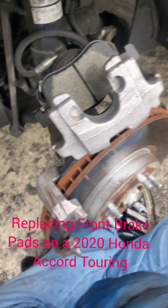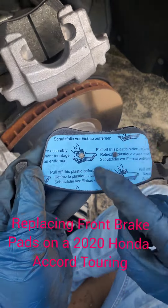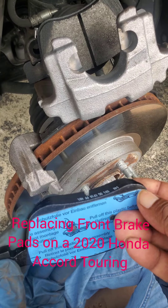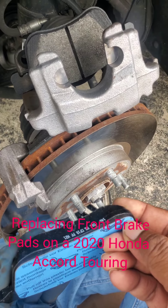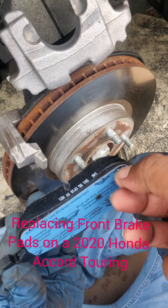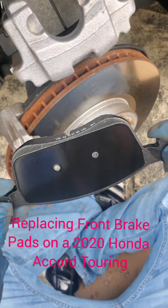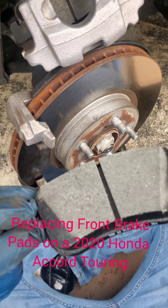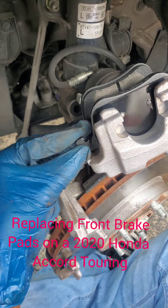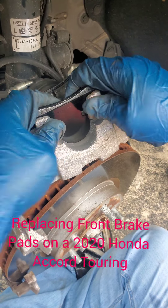Make sure you check that it's completely in. Then you take the other end — the backing paper has to be peeled off. You might get a little irritated because there's not an edge on it; you actually have to make one. Once you have it, pull it off and make sure it does not get any dust on it — don't rest it down. The minute you pick it up, take it, set it in position over the clip, bring it in towards the bracket, and press it in firmly with your hands.